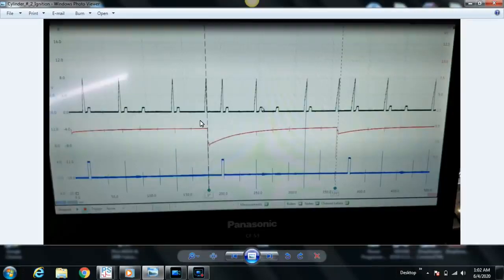It was really more just a quick comparison from one to the next, mostly just to demonstrate this scope. Really, with a broken car it's kind of like a cherry on the top. So that's how we do it, but in this case I'll just cover some of the basics here. We have a phase ruler at one ignition event for cylinder number 2, the second phase ruler lined up here with the next ignition event for cylinder number 2. Of course, at 720 crank degrees we would expect to see 4 ignition events, 4 injector events in this case, because they share the same fuse for that bank.